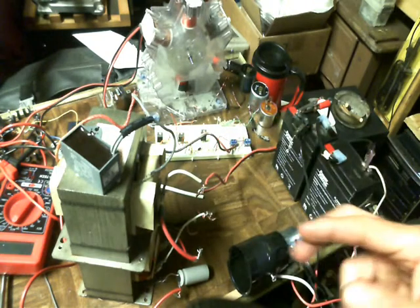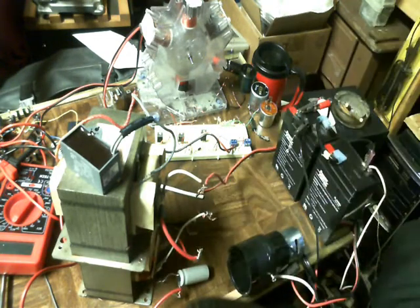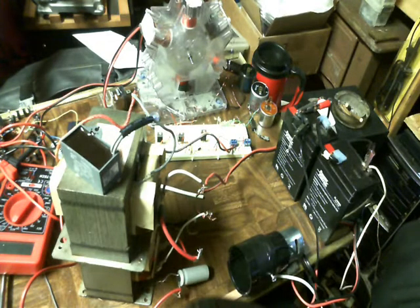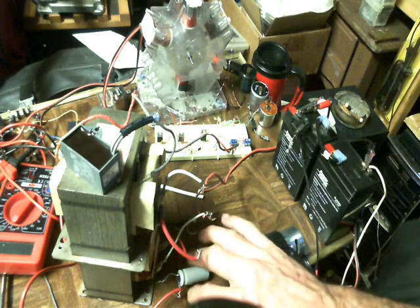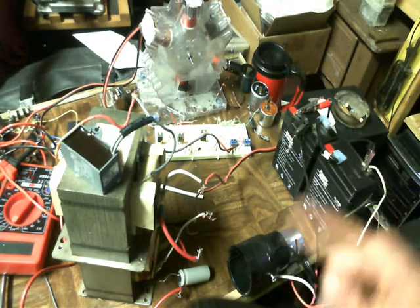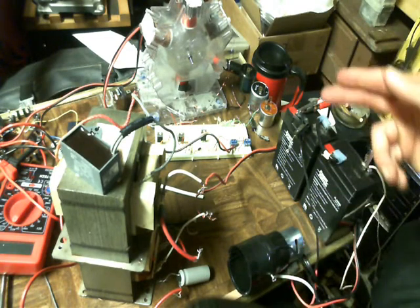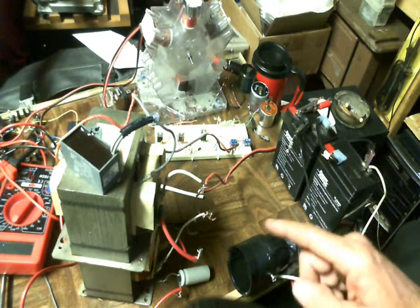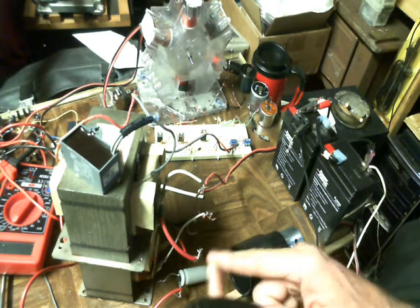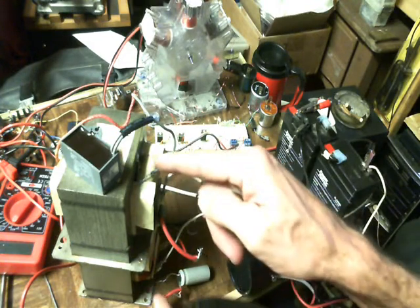And so when that happens, when it makes the circuit, you get a strong pulse inside the primary on there, which saturates the core. And when you release it, when the field collapses, you get a high voltage pulse out of both of these secondaries right here. I'm going to go ahead and turn this on. It's going to get obnoxious because this motor is not going to run constant — you're going to hear it going because it's making and breaking the circuit. I've got the motor actually running through the whole system, so it actually has to run the motor to make and break the circuit for the positive. Every time the contacts inside there connect, it energizes that coil. When they split apart, it allows the field to collapse and you see the back EMF result as the two sparks.